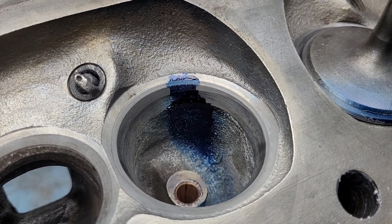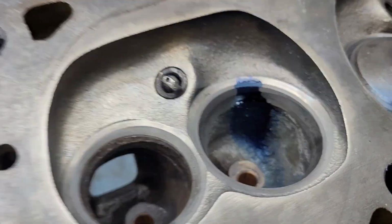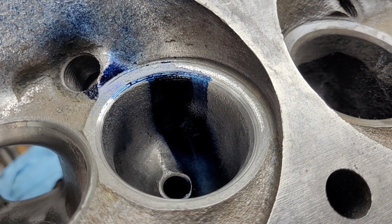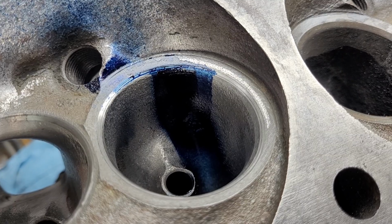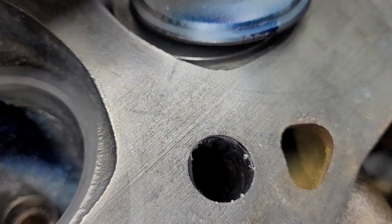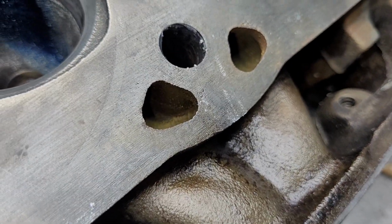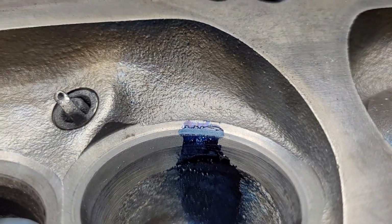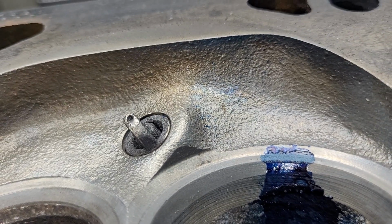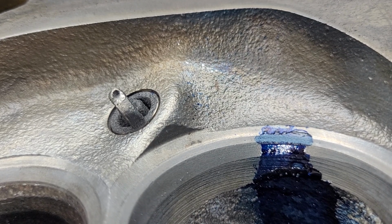But I think it's interesting what we've got with the Dykem. Take a look. Very, very similar to my ported 360, right? Not that much different, really. I think my ported 360 is a little better. But notice the bone stock valve does not have a back cut that I can see. It looks straight to me. It looks like a big wide 45 to me. And on the chamber, let's see if we can get some extra light there. I don't know if you guys can see that, but you've got blue right along this edge, almost like a shearing edge.